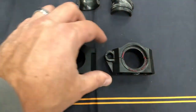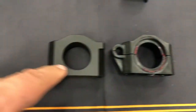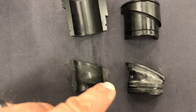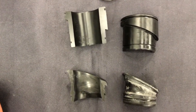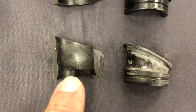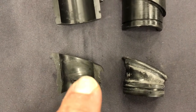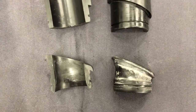The BDX one is simply wider. You can see how the stock one has a step on it on each side, whereas the BDX one doesn't have a step, so there's just more surface area on the shaft itself. On the upper one, you can see how the stock one's angled versus the BDX one is full height. There's just that much more surface area, and if you look closely at the bottom of the stock one, it's tapered — you're actually only getting a very short area of the bushing touching the shaft, versus the BDX one, which is virtually double the height. In general, it's a tighter fit.